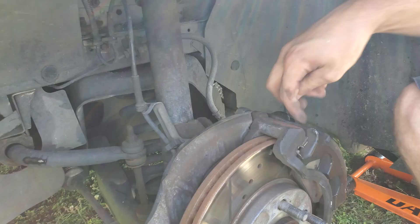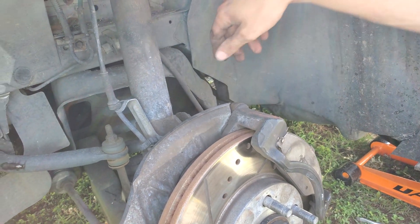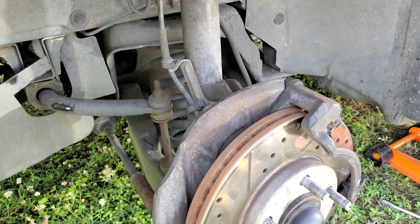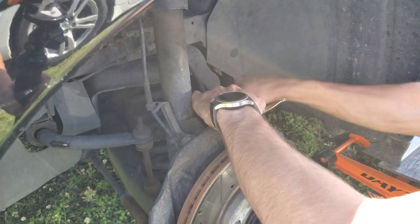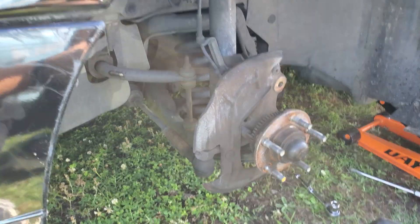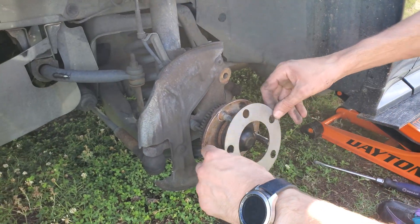Once we got those screws off, we need a screwdriver to go in here and bend it up like this — that's all. Once we get rid of that line, let me see how this brake caliper looks. Now we have to take the caliper bracket off — that should be a 16mm. Just hit it a couple of times and it's gonna come loose. Then we take the rotor off and then we got this piece.